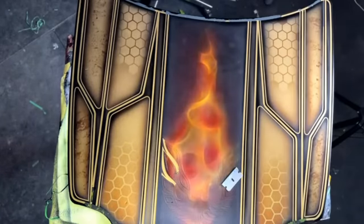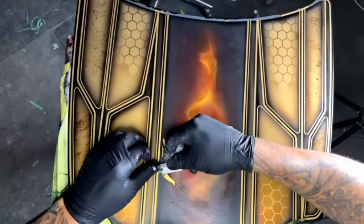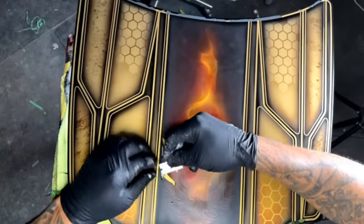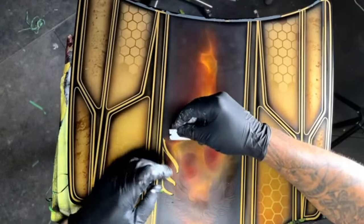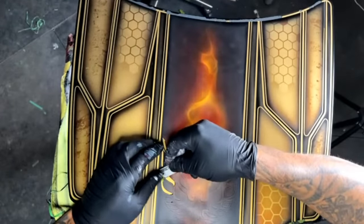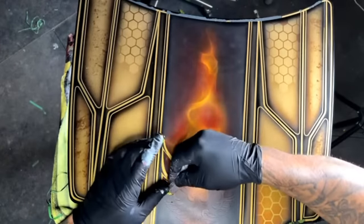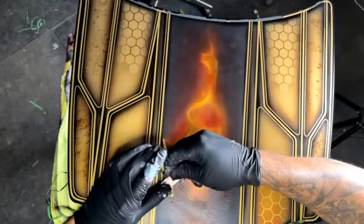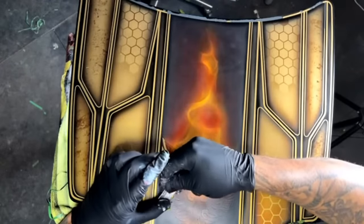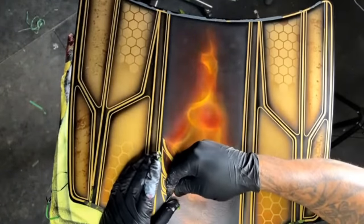Yeah. Well, actually, the way I would fix it would be to clear it, and then I would repaint those edges. I did rush this thing when I went to try to get it done and ready today. So, yeah, it's my bad. This panel was actually cleared with a matte finish, which was a little deceiving because when I go to scuff it up, it looks like it's scuffed, but it's actually a matte finish. And I guess I just didn't hit it hard enough.